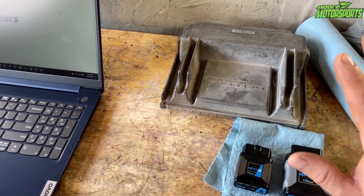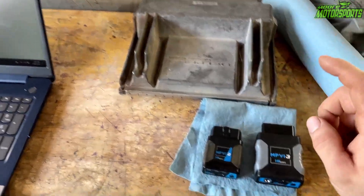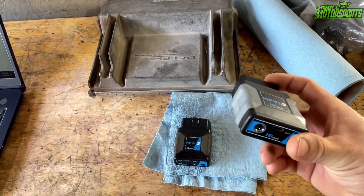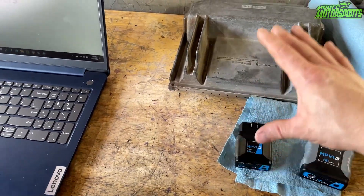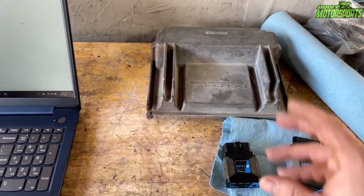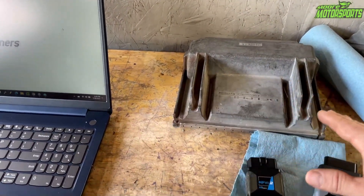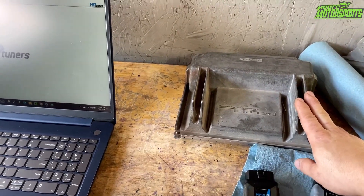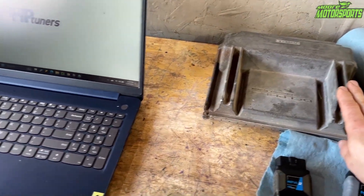I recommend when you get the two credits to do it this way, because I wasted two credits on mine — two credits is a hundred dollars, so I basically wasted a hundred dollars. Jacob brought his so I can show you how to unlock them. This is going to be for pretty much any LS swap. You're going to need to unlock the vehicle anti-theft at the bare minimum just to get it to run, otherwise it'll crank and fire up for a few seconds and then die because the vehicle anti-theft kicks in.